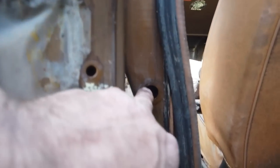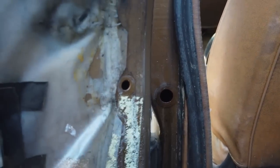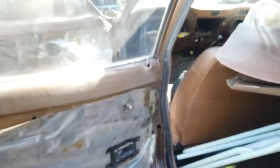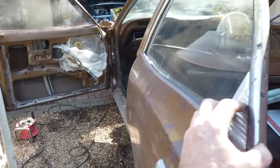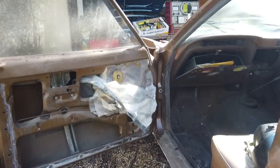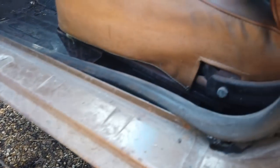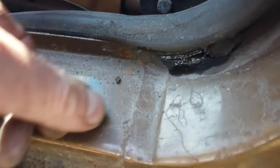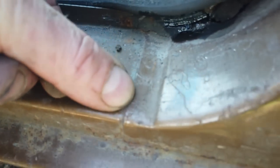These door switch wire plugs are great for getting in the B pillar, so blast straight into there. They're great to fill the B pillar up with the ML. The reason you use ML here is because you need it to creep into this gap. A thicker rust proofer won't get in and seal underneath there. We're hoping it's even going to come out at the edges eventually.